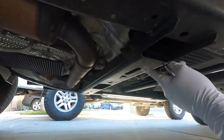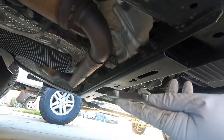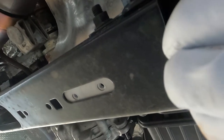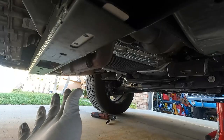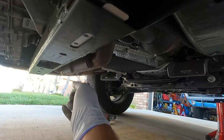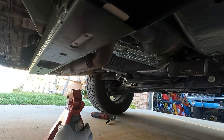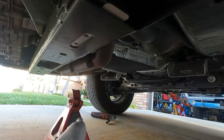Coming back to the transmission crossmember, these are nut plates that go into that crossmember. They go with the nut facing up and the round part facing in toward the center — just slide it in until the two holes show up in that large oval opening. Do the same on the other side, sliding it in from the end. The instructions say to position a jack stand right up underneath the exhaust pipe that runs parallel with the transmission crossmember. I'm on the ground without lifting the truck, and I've taken the top part out of the jack stand to get it a little lower — about three inches down versus the recommended five to six inches.